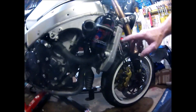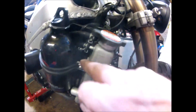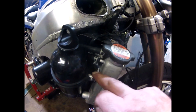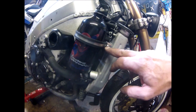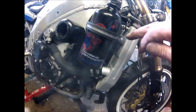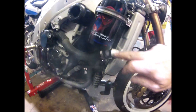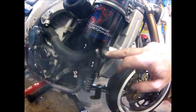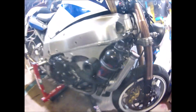The bottle's on — Spider-Man's got a headband. That's the bracketry: it went to the bolt that holds the fan housing on, and I've stuck a 5mm marine-grade bolt through that. It was just touching the pipe, so I've snuck a cable tie around it to stop it chafing the pipe, but it's pretty solid on there.